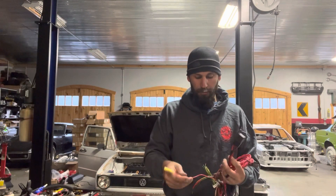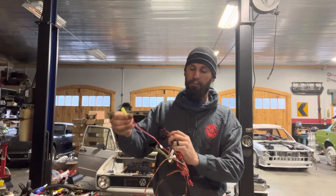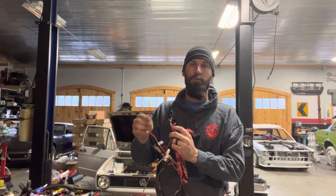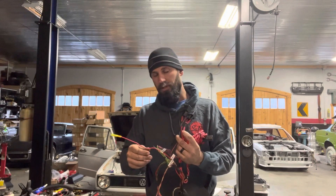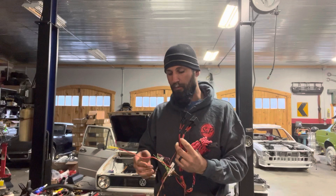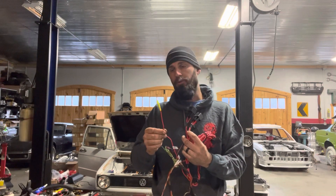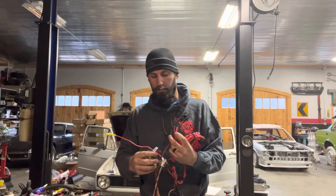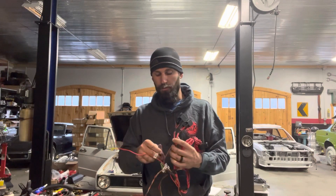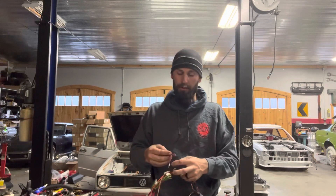The one from the fuel pump has a lead that says 'fuel pump positive.' You're going to power your fuel pump from this wire. One way or another, this must power your fuel pump so that your ECU is controlling it. Everything will work like it is designed and came from the Mark IV setup.